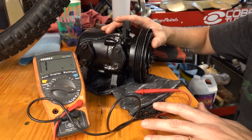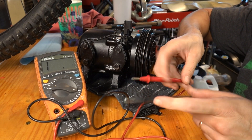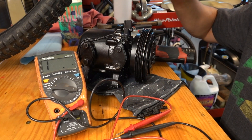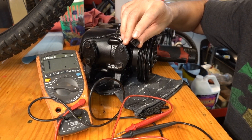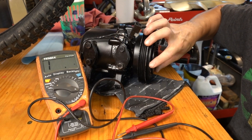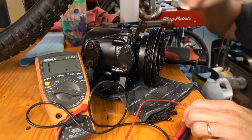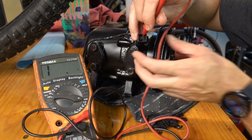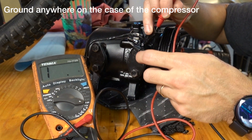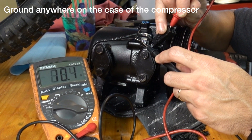This is going to be super easy. Got my meter on, got my two leads - a positive and a negative. It doesn't matter which one you use. When you're looking at your compressor, it's going to have two lines going in - you'll see a connector. All we need to do is use this wire to find out the resistance in the compressor clutch coil. Just stick that on the terminal that's in there and then ground this to the same ground that's on the compressor.